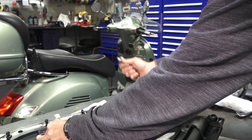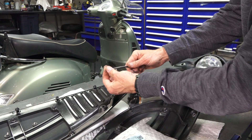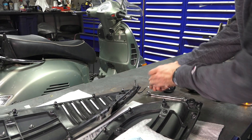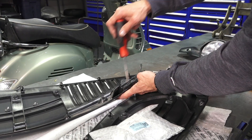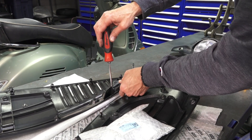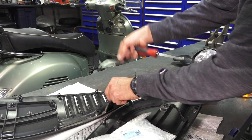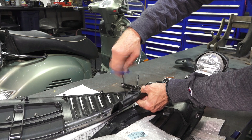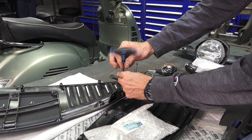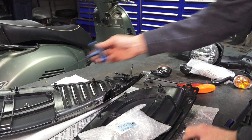They use a small connector because it passes over the nut that retains the pod turn signal. You're left with the adapter. Remove all the fasteners here — T25 Torx — and the little outer plate will come out. Last, you'll need a 3mm Allen wrench. Now you have all the parts removed. That 3mm Allen goes right back in place; it holds the fiberglass-impregnated plastic piece to the aluminum outer skin.